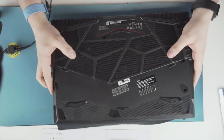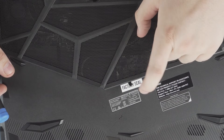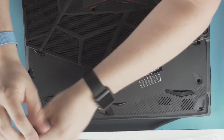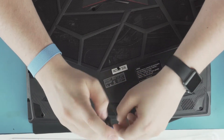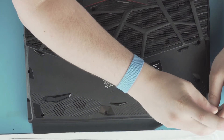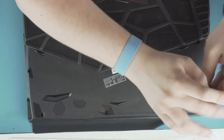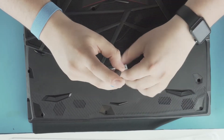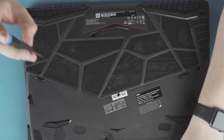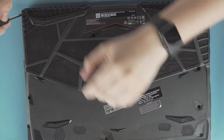To start with the dismantling, we want to take out the back screws. Make sure you always puncture the factory seal — there's always going to be a screw under there. All these screws on the back are the same size so you don't have to separate them out by size. Some of the openings for these screws are a little bit deep, so you may actually need a longer screwdriver to get in there.